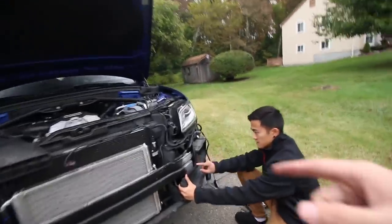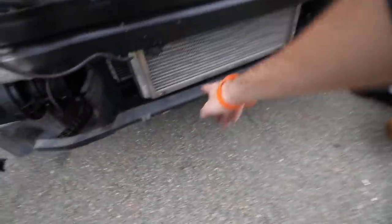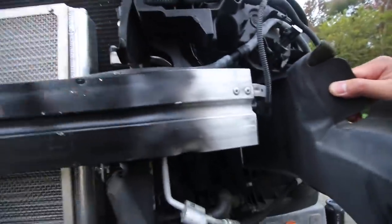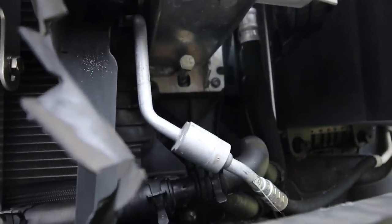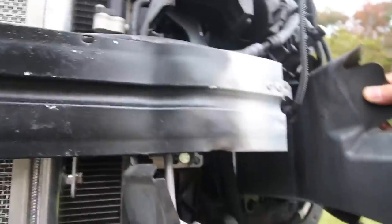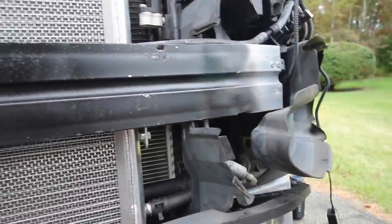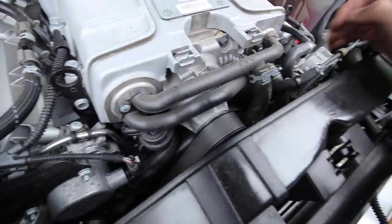Lots of steps have been made - we undid this bolt up here, this bolt up here. There are three bolts that hold this whole front end unit together: two on the top, one on the bottom. I replaced the bottom one with a much longer bolt so we can pull the whole front end out and it'll still support its weight. That should allow us to get the pulley removal tool in there, loosen the belt, etc.